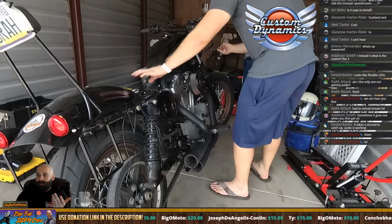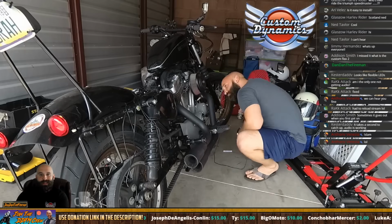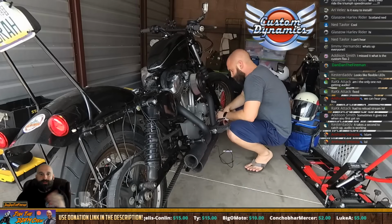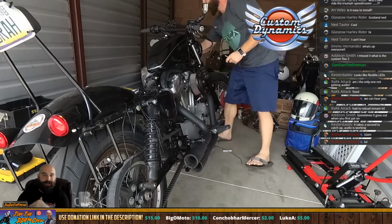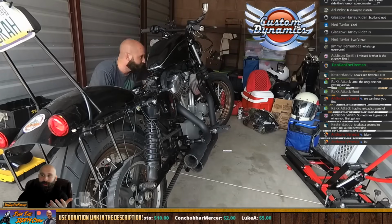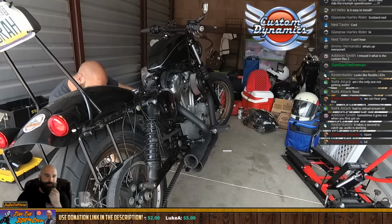But yeah, definitely test it with the battery pulled out of the bike. You can connect the negative and positive terminals of the lights just to the battery. Don't worry about the bike. Just pull the battery out of the bike and test it, constantly if you have to. The lights run off the battery, not the bike, so you can actually have the bike completely off and have the LEDs running. Obviously, you're going to drain your battery if you have them on for a couple of days, if it lasts a couple of days. But definitely troubleshoot it by not having to reach in, plug it all in, reach out. Just pull the battery all the way out.